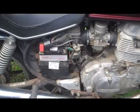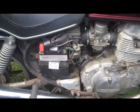This is in contrast to when you're jumpstarting a car, where they say you should have the donating vehicle running. But motorcycles don't really have the robust electrical system that vehicles do that can handle the kind of amperage, or the amps that come out of the alternator. So it is possible that you could fry some wires if your car is running, and if the motorcycle that is donating the electricity is running, that could also be damaged. You just want straight battery action.